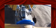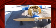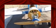In fact, I might just go maybe one degree off. Basically, I don't think I needed to cut into my sensor bracket to get such extreme range. I think it would run just fine at just the stock end range — probably about 31 degree timing. I think it will run really well right there, because both 35 and 30 degrees seem pretty darn good. My opinion, I think 30 is a little better, but it's hard to tell. They both seem to run really well.